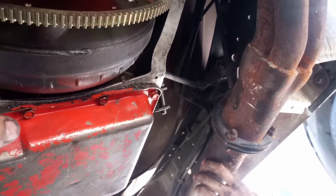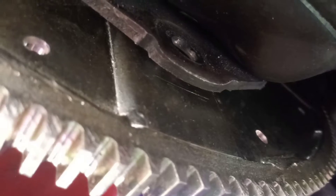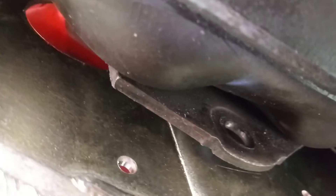And there is a critical side to these flywheels — you've got to put them in right. If you put them on backwards where the flare didn't — when you put them in, see how that raised edge is out? That's the way those go in. That's the way the flywheel goes in. It's face out. Some flywheels say 'this face out' or something, but this one didn't.